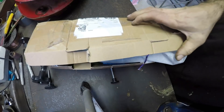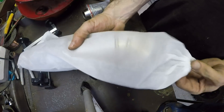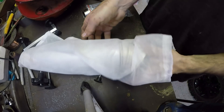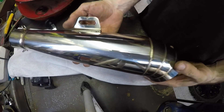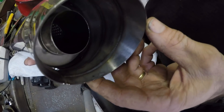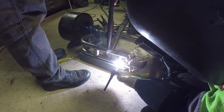I'll hook it around the corner at the back a bit later and I'll have a sports muffler — again to be a bit different. I'm actually planning to use this muffler. It's a GP Moto copy and I think it's going to look amazing — really well built and it's a stainless steel unit; the welding on it is amazing. That's two inch — I'll taper it down to inch-and-a-half, and then taper it further where you can't see it until it goes to inch-and-a-quarter. I'll make it look pretty cool just sticking out the back.